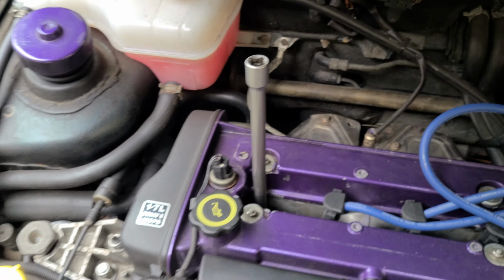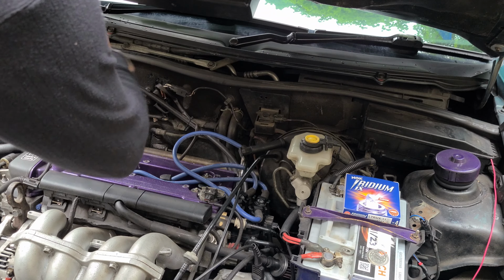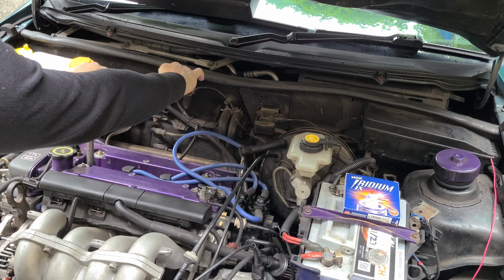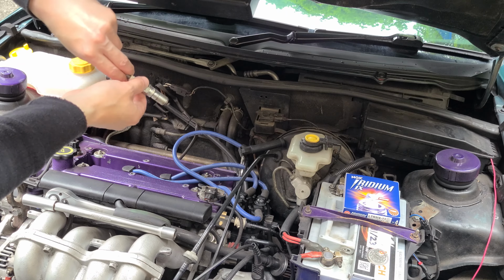So then just simply get your ratchet on here like this, and then it will be a bit tight, so you just want to go like that, loosen it off. And then you can just do the rest by hand now until you feel the spark plug is loose, like that. And then you just reach in with your fingers, grab the top of the spark plug, and out